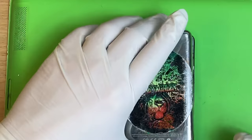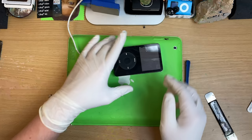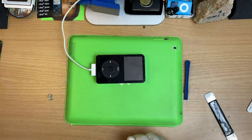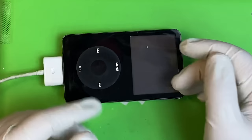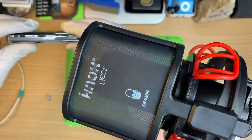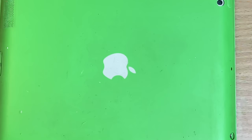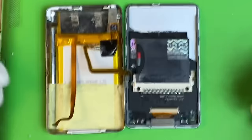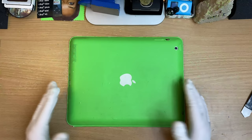Plug the battery in — before you clip it together, have a go and see if anything happens. Not good — that's what happens when you pull an iPod out of the junk pile. Let's seal it up anyway and pretend it works. Just to show you what a flash-modded fifth gen looks like on the inside: iFlash kit, 256 gigs, and a massive battery to make up for the extra space gained from taking the hard drive out. This thing's a monster and it's lovely. At least one of these turns on.